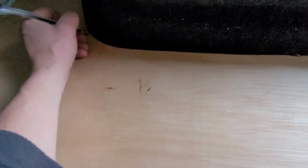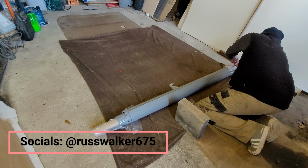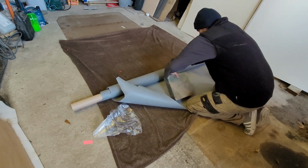So looking around, maybe the same here, from sort of here around to here. I want to add another 5mm to the Altro flooring before I cut it, to make sure that it's right in there. And the same here. I'm going to add in 15mm into this corner, so I know that's going to finish up nicely on the floor. So now it's time to roll out our new Altro flooring and get those boards laid on.